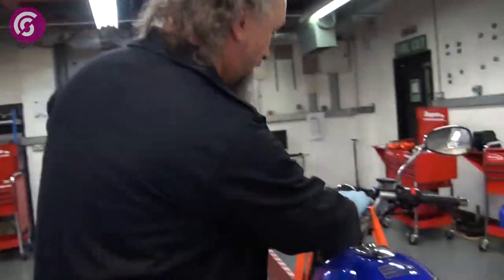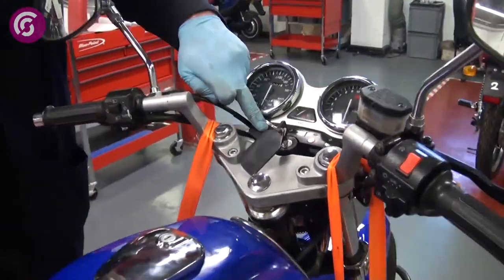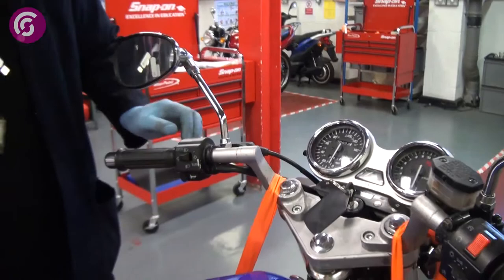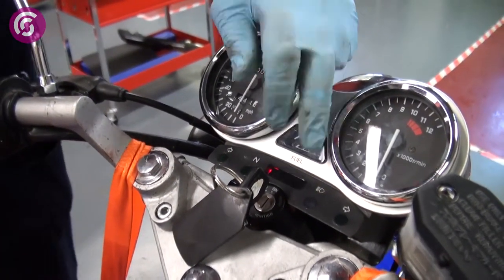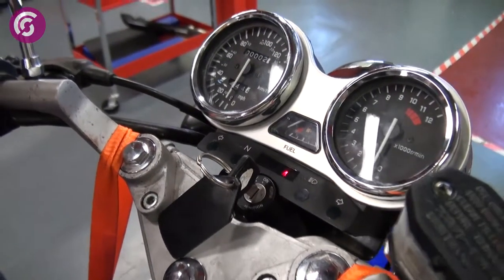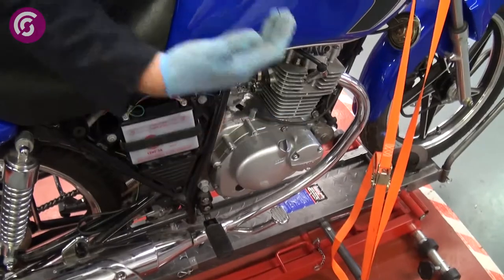On this model it's one down, four up. Switch the ignition on and you should get the green light, which means it's in neutral — the back wheel can spin, there's no drive, so you can start it. You go into first by clicking it down. We've actually got a gear indicator on this one, so it's got a little one lit up. Then we go to second, third, fourth. Because the gearbox and the engine is one complete unit, for lubrication the gearbox actually runs off engine oil — the same oil you put in when we did the oil change.